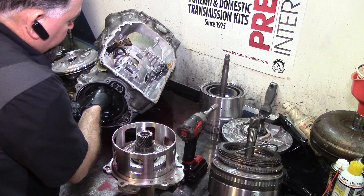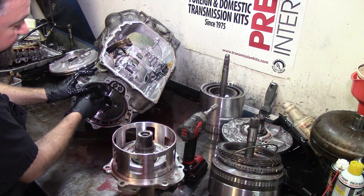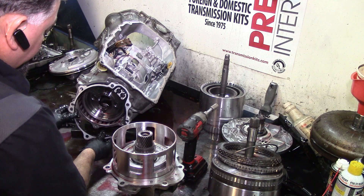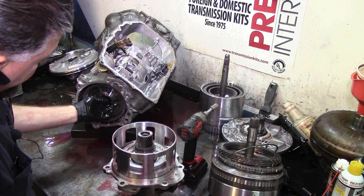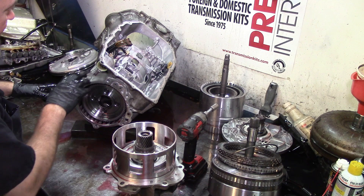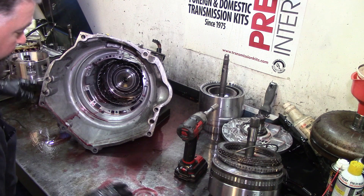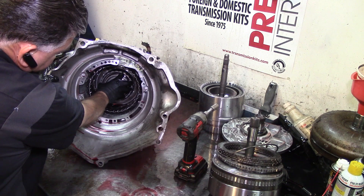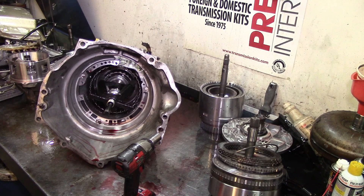It's not going to come out — this is the one that has the hub that goes all the way up. More pieces coming off. One of the clutch packs has lost its teeth. There's a molded gasket. Guys, I'm going to put you on pause. I've got to figure out how to split this thing. I might get my puller in there. We already have some damage here on that piston. Hold that thought, I'll be right back.